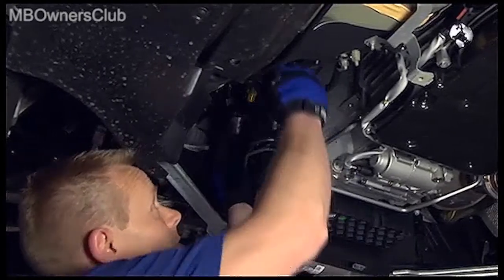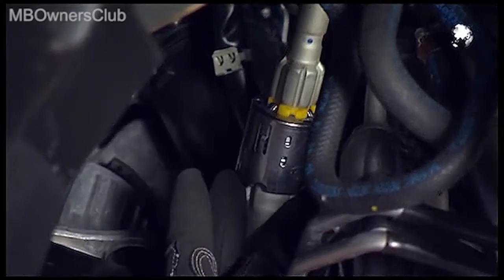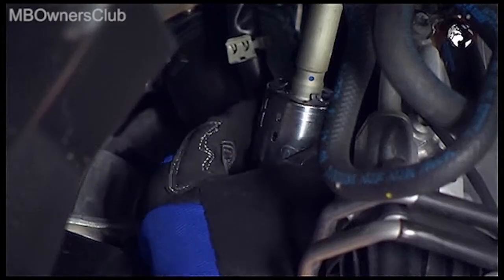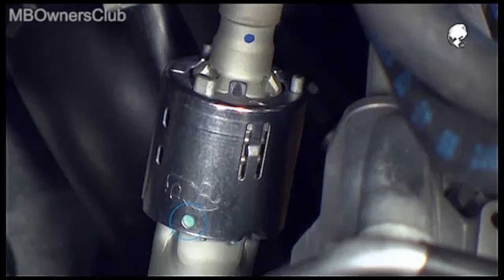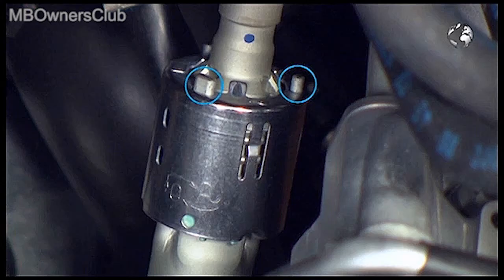Assembly is just as simple. Place the steering shaft all the way into the lock — you can see and hear how the lock latches into place. The steering shaft can only be locked into place in one position, and it must slide into the lock without pressure. The lock is fully closed when the green marking is fully visible, the pins have raised at least 0.5mm, and the tabs lie flat around the steering shaft.